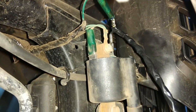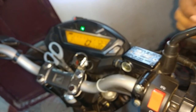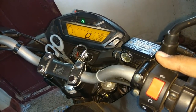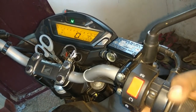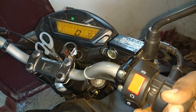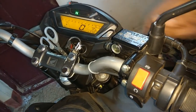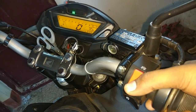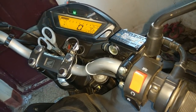I have connected it temporarily. So let us start connecting the engine. Now the kill switch is on - let's start it. The bike is going to start now. As you can see the electronics are all on, but the engine is off. Now let us start cranking the engine. It won't start because the circuit is not ready and we have cut off the current going through the engine. So let's try. As you can see it cranks up easily but doesn't start - the kill switch is working.